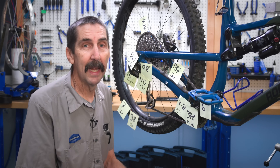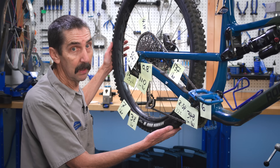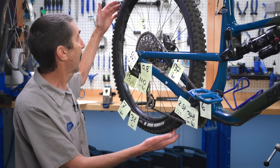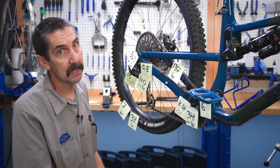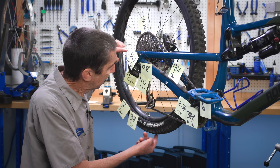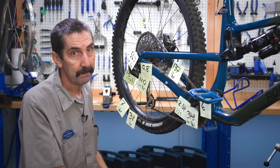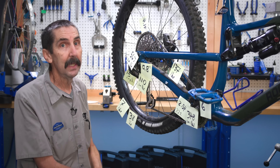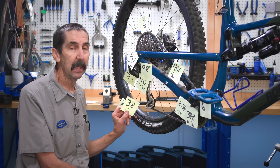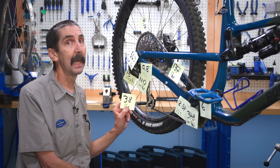Still, we're not done — we have another wrench to throw at you. The last wrench is that wheel. This is a 29er, but if you actually measure the tire outside to outside, this one is 30 inches. The wrench radius — here to here — is easy: 15 inches. A 15-inch wrench. We finally get down into the dirt — we're seeing 38 pounds of pull in our easiest gear. That's what's getting us up those climbs.